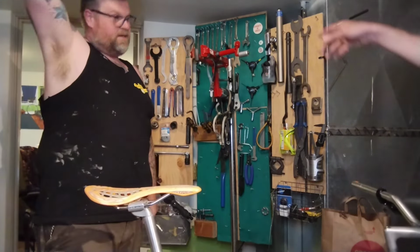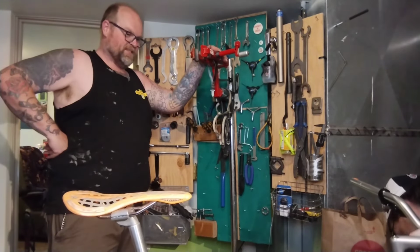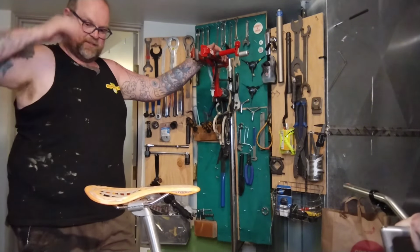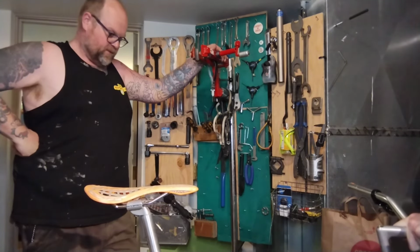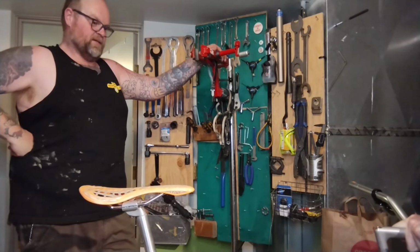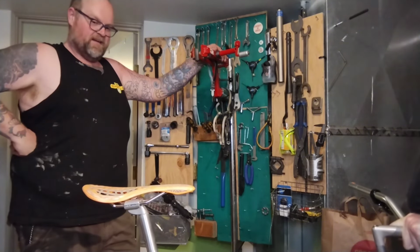Cool. We'll grab the 15 for you. Yeah, double check this front wheel. Yeah. I was like, maybe that's what it is. Yeah, something's wrong. I bet it's just these shitty brakes, just having a bunch of play in them. I'm gonna loosen them up and tighten them down. Tighten those bolts, the dual pivot bolt a little bit or something. You gotta be careful because if you tighten it too much the brakes don't work at all. Yeah. Not enough to have a little play.